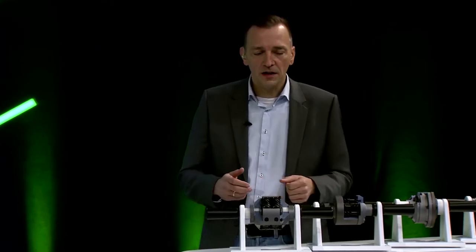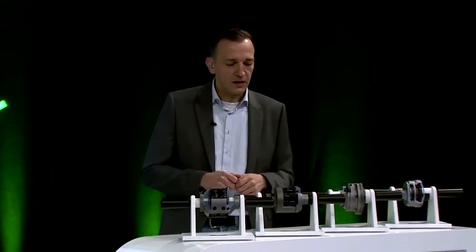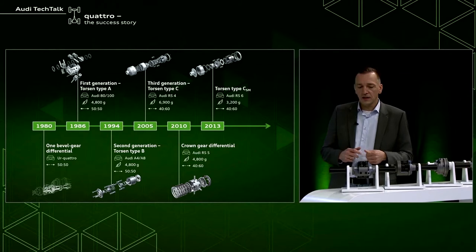And that's also the case to this day in off-road segment cars. You've got these full differentials that simply block that torque leveling, which means in off-road conditions I've got super traction and all the advantages, but of course, other disadvantages. For example, when parking, I've got a tensioning of the vehicle that is not really suited to a passenger vehicle. And also the brake control systems that started in the 80s were not compatible with a fully locking mid-diff. And so, as of the middle of the 80s, one started to come up with different technical solutions. That is the self-locking mid-diffs.